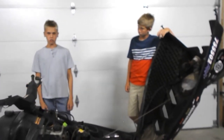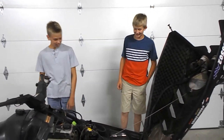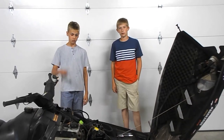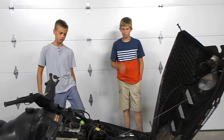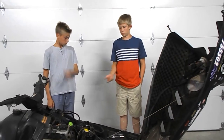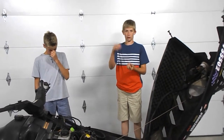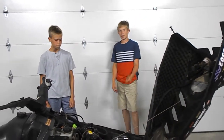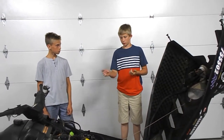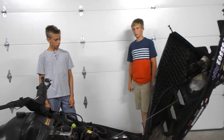Check the choke — you might be getting too much fuel, so check the choke on that. And again, check your gas. The air box: if there's rust in there and it gets sucked into your engine it can wreck your engine pretty good. Carburetors have a venturi — make sure that's not clogged; go into your carburetor and check the venturi, which adjusts when you pull the throttle to let more fuel and air in. Your float bowl where the fuel sits before entering the carburetor could also have its adjustment off, so look into that. Maybe get a new carb if you can't figure out what's wrong.